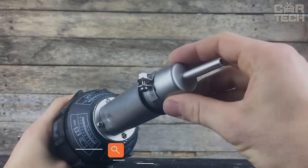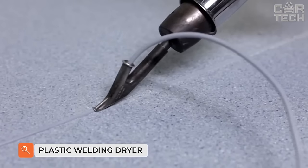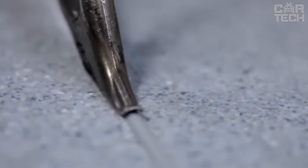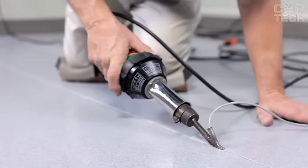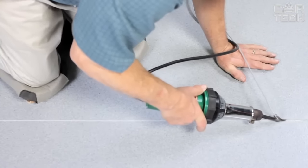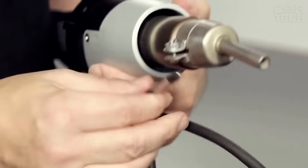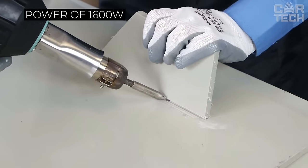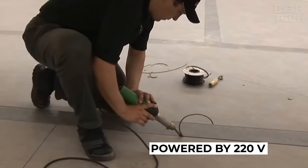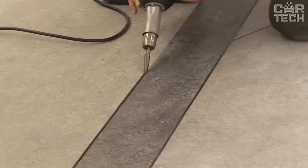Plastic soldering dryer is mainly used for repairing broken bumpers and other plastic parts — less often, dashboards and interior elements. Furthermore, the device is used for soldering pipes. The hair dryer comes with a set of nozzles for soldering damage of different degrees. The hair dryer has a power of 1600 watts, operates from a 220-volt network, and can heat the element up to 700 degrees Celsius.